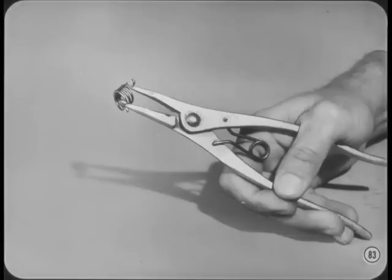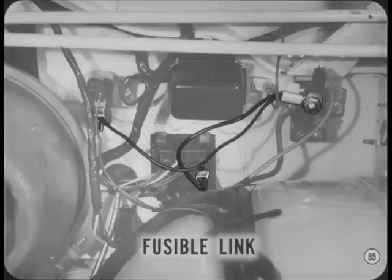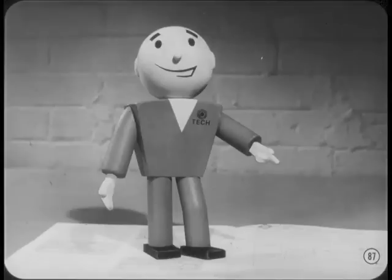How do I check whether the pin is causing parking problems? Very simple, Bob. Peel back the protective boot and see if you can turn the trip release ring. If it moves at least one thirty-second of an inch, the over-travel mechanism is okay. There's one more thing you ought to know about, Bob. We have additional protection in the wiring this year. There's a new fusible safety link between the starter relay and the ammeter. That story about the fusible link is real important, as well as interesting. But we're running out of time, so all you technicians had better check the reference book for the complete story on this and more details about the other circuits we've been talking about.